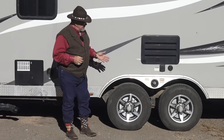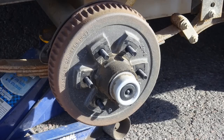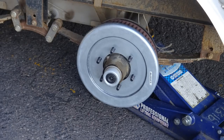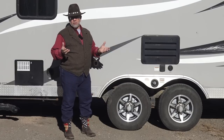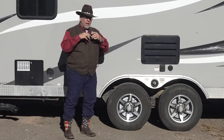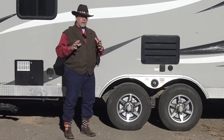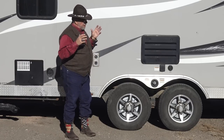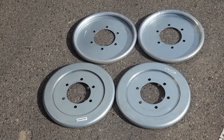These Centromatic balancers that I use have been around for 40 years. They are a ring on a disc that goes right behind your wheel — you pull your wheel off and shove these discs on there. The outside ring is what balances them. There are stainless steel BBs inside that ring, held in synthetic fluid so it won't freeze — it's good to 50 below zero. As you drive, those BBs roll around in there and find the imperfections in your wheels, finding where it's unbalanced or starting to cup. The BBs move around and put weight in that area, just like the weights they pound on or glue on that all fly off. This constantly does that every time you drive.